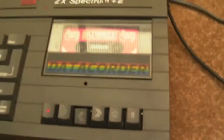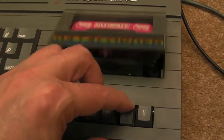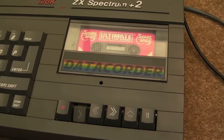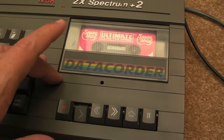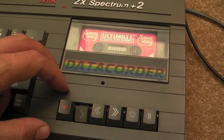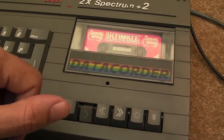One of the things you'll notice here as well, from my other videos, is I re-enabled the motor in this and I've been using the tape deck. It needs a new belt because it starts struggling halfway through the load — you can tell it starts slowing down. I'll do a separate video on the belt replacement. You can heat the belts up in boiling water to give a bit of life back to them, but it's not a long-term fix so I don't see any point in doing that.